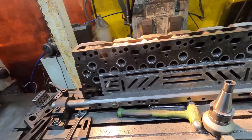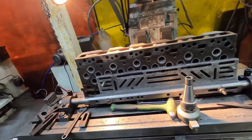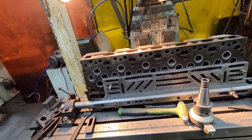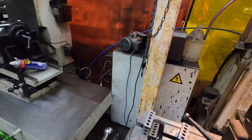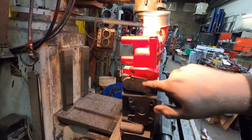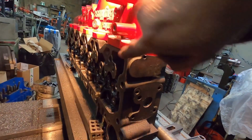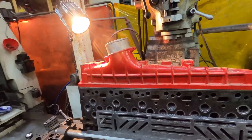I'll make up a video — I don't know if it'll be tomorrow or when I get to it — and I'll show you guys the whole process, maybe time-lapse a little bit of it, showing how I mark and put your intake on there. Your intake brings everything back straight again. The reason you put that five-degree angle on there is so you don't lose where your valve cover sits right here — otherwise your valve cover gasket gets cut off. Don't ask me how I know that — very first one I ever did.